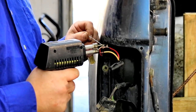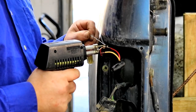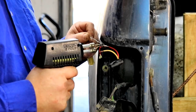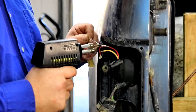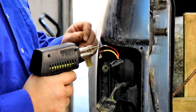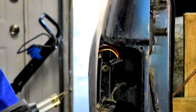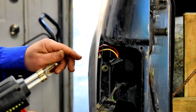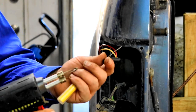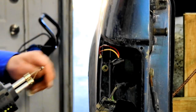I like to solder my wires - I've never had real good luck with just crimping them. So I take a quick second to solder my wires so I never have to worry about it. What I did is run the wire behind the light and through the chassis up to the front to the switch, so it's all protected from weather. We got some conduit in it on both sides so the wire is protected.